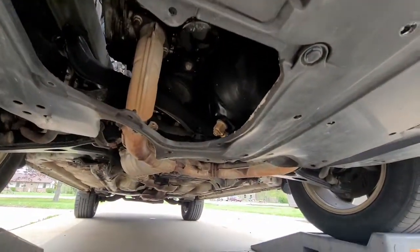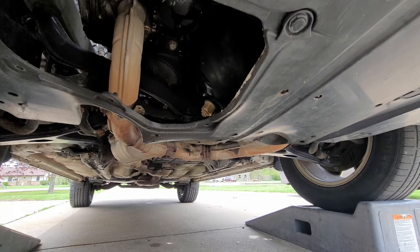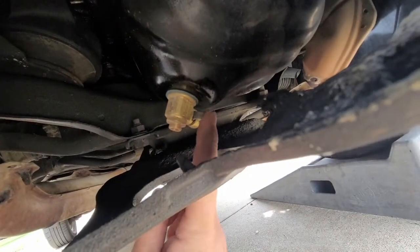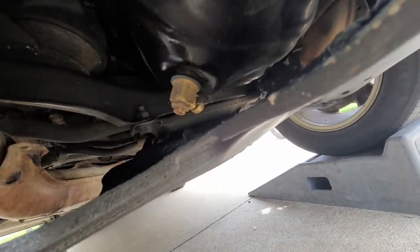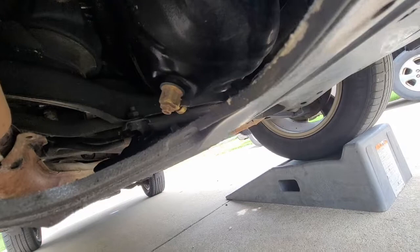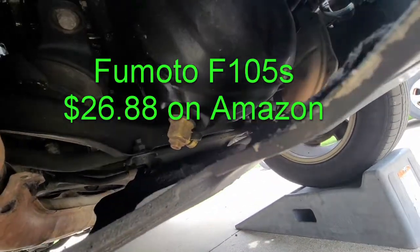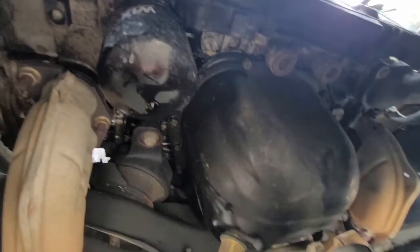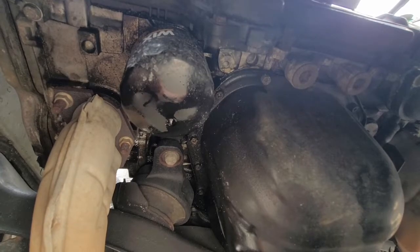This car, just like my truck and my other Subaru, I've got the Fumoto drain valve. All you have to do is move this little lever down and the oil comes straight out. Super handy — you don't have to worry about finding the right wrench or socket. All you do is flip a lever. I'll put a model number and price up on screen and in the description. Right above it is the oil filter — you can see that, it's a Wix as well from the last time I changed it.